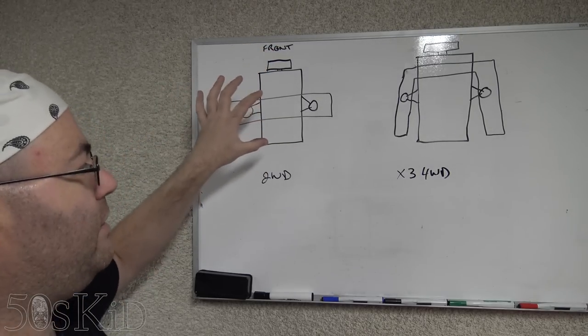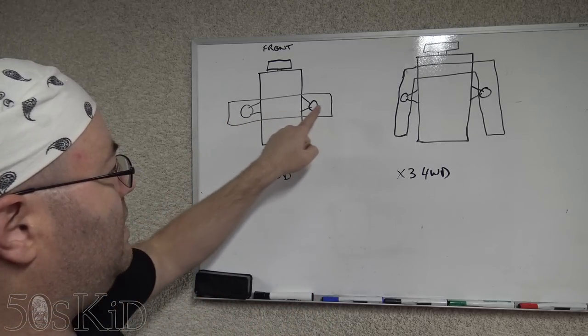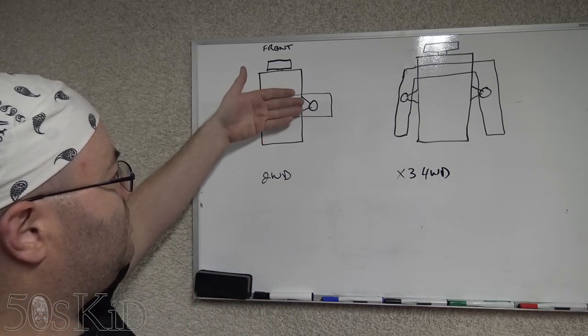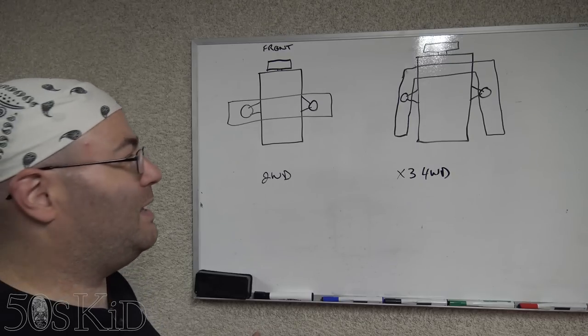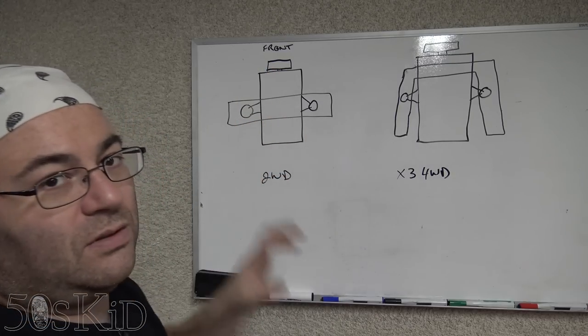You're looking at it from underneath or from above, it doesn't matter. This right here is going to be the subframe that the engine sits on. And on an E46, all you got to do is lower that subframe away, and then you'll be able to get the oil pan off. I know a lot of you think it's stupid that they did it that way, but that's just the way they did it, and it's not that uncommon for a longitudinal engine like that.